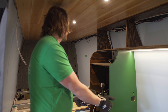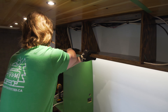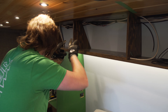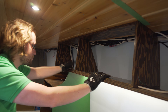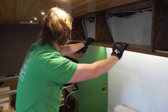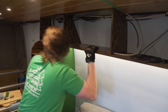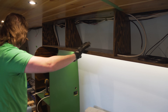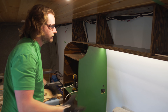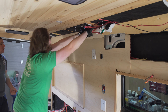Here's another van I'm building where I've got a little bit of my upper cabinets in. The screws that hold this up are well hidden, but there are probably about half a dozen that go right into the metal body and the top rib in the Sprinter, and then probably another half dozen screws that tag the ribs going across the roof in the body. I'm quite confident these cabinets won't go anywhere — I can get the wood to creak on its screws a little, but nothing moves. In fact the whole van will shake but the cabinets move with it.